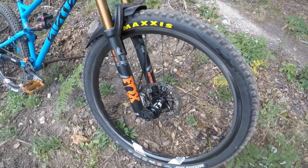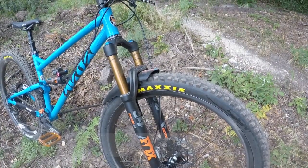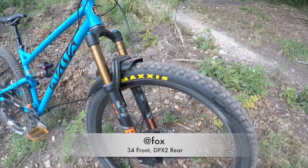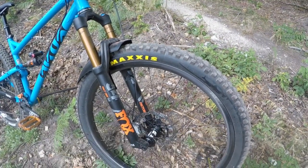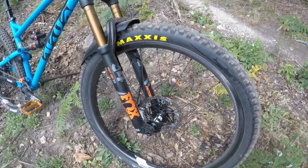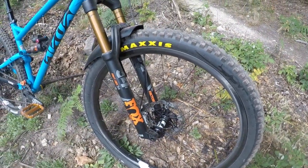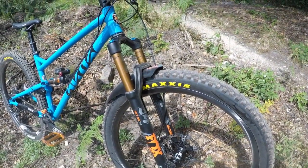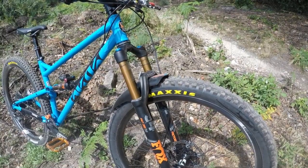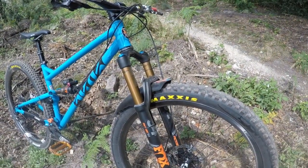Thanks to Geordie at Fox, I'm running Fox suspension front and rear. I've got the Fox 34s set to 130mm travel to match the travel of the bike. They're currently at 70 PSI. I put four tokens in there because I like to have a little bit of progressiveness in the fork — just a little bit more than the standard setup. I'm 68 kilos, the rebound is seven clicks away from fully closed, and the compression at low speed is 10 clicks out from firm.